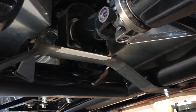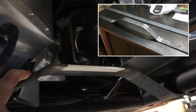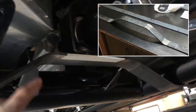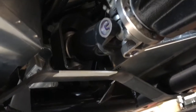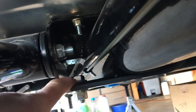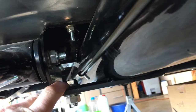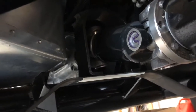What I did is I just bought a piece of ¼ inch by 2 flat bar steel and fabbed this — I just bent it. I had to use a torch, used MAP gas actually, and did some trigonometry to get these angles right so I could get it close to the drive shaft. The beauty of this is I'm just using ½ inch bolt hardware to bolt through where the control arms are, and it's rock solid — you don't have to weld that.